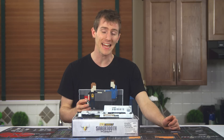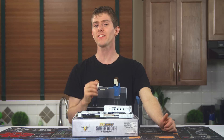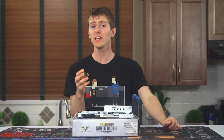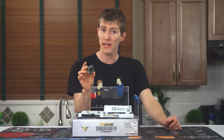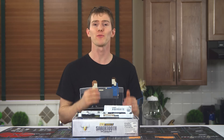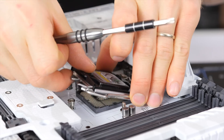For our CPU, the choice was obvious. The Core i7 4790K has a wicked 4 GHz clock speed out of the box without even factoring in turbo boost. It doesn't kick off a lot of heat, which is great for keeping temps cool, and is basically the top tier CPU of choice for gamers everywhere who don't have any use for extra cores that can be had on the premium LGA 2011-3 platform. Now normally I copy-paste these CPU installation instructions — not today. Forget about lifting the retention arm, putting down the retention arm — no, really forget about the retention arm. We're going to remove it.